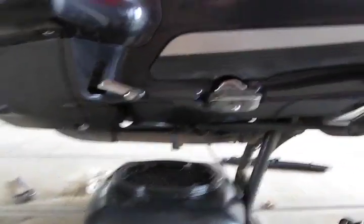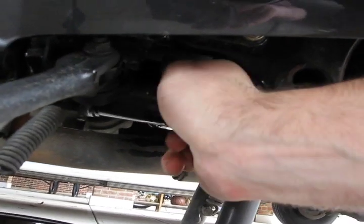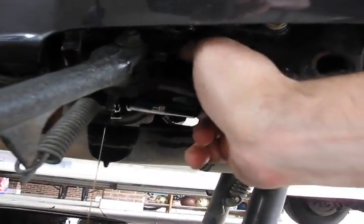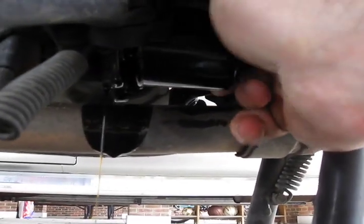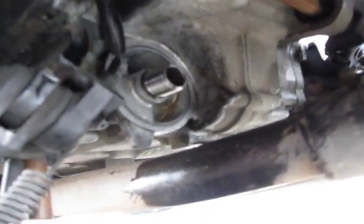Reposition your oil container so that it's underneath the oil filter. Put your side stand down — behind the side stand is your oil filter. Loosen it until the oil spills all over your exhaust pipe; this is actually normal. After a few minutes, oil should stop draining. Wipe everything with a rag, including the exhaust pipe.